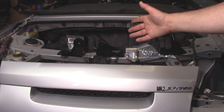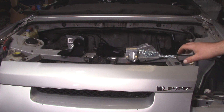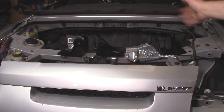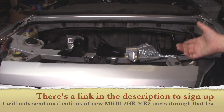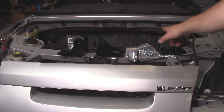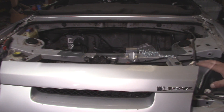The only thing that leaves is the right side motor mount, which doesn't currently exist. I will weld one together for this build, but the intent is to actually make it a production part that will be available probably before this build is even finished. So if you want to follow along, feel free. Now that doesn't mean it'll be fully bolt-in — there's probably still gonna be some exhaust work you'll have to do, but since you're going to have to cut out the panels in here, this is not an amateur-level swap anyway.